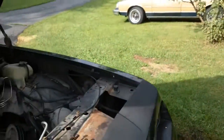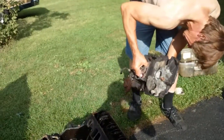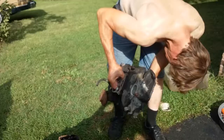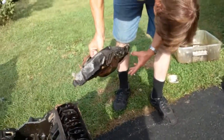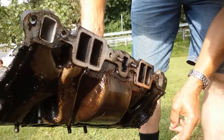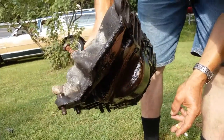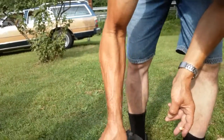Somebody had it working with the shitbox back on. They even got the block-off over here on the coolant side, so it couldn't go through either side of the head — in the back. Real intelligent. I wonder what the purpose was behind that — so the motor could overheat internally?